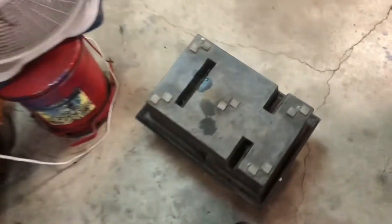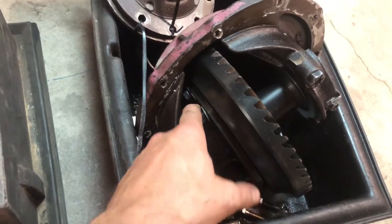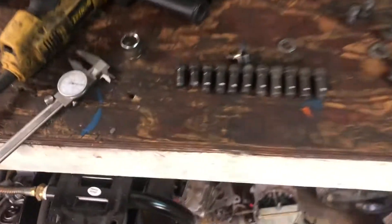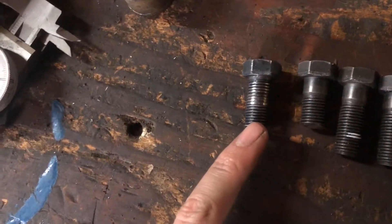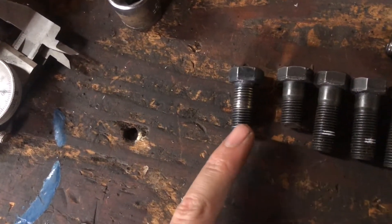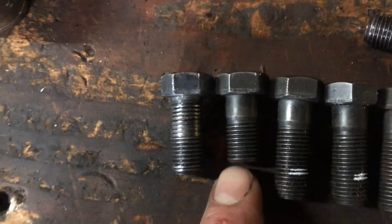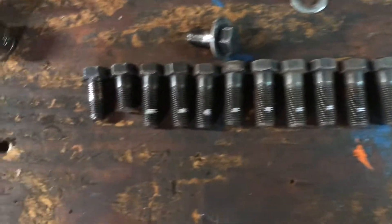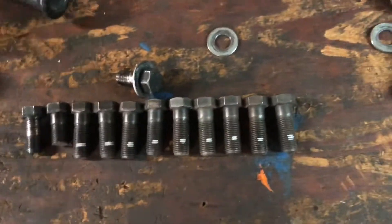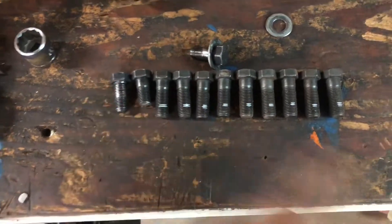What I've got going on here now is my gear — ring gear bolts. If you guys remember, this is my other gear that I ran on the shorter tracks, and the bolts all came loose. The reason they did that is because they're too long and they bottomed out in the hole. Here are the original bolts that came loose. Thank the Lord they didn't come all the way out or snap and go through the gear set, because the gear set still looks perfect. I've got a whole new set of bolts and I'm trimming them down — taking about two or three threads off — so they'll be short enough to go in there and not bottom out. Marked them all up with a paint pen and a dial caliper. I'm going to chop them — they're real hard material, so they don't go too well with the cutoff wheel, but I'll work my way through and get them all done.